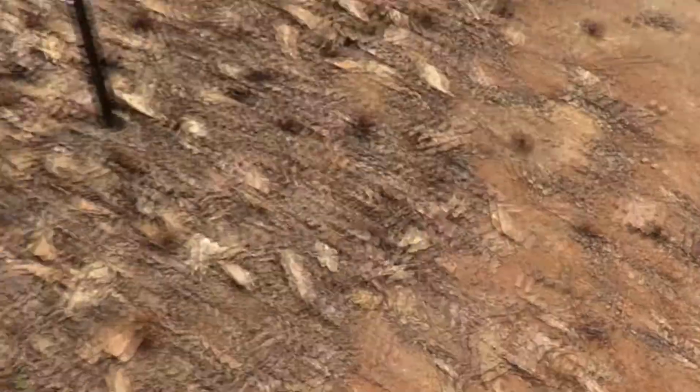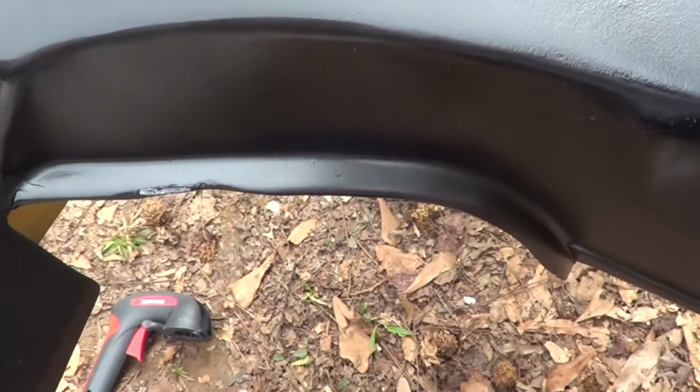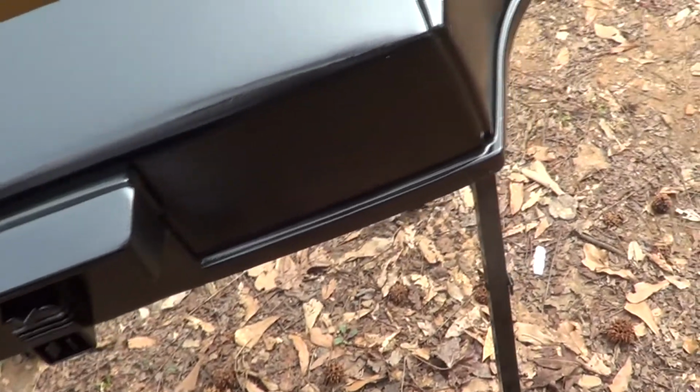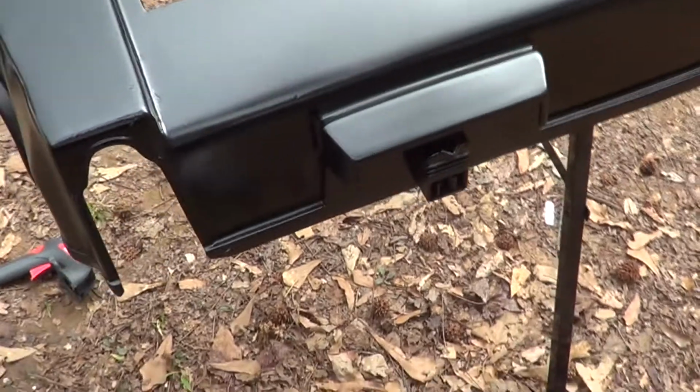And there's also, from that clear coat, I'm getting that spider web speckling again, so I might not even put a clear coat on it or try doing it further back. I don't know. I kind of looked online and saw several different reasons why. I think the most common thing is spraying it too close or on too thick. So anyway.